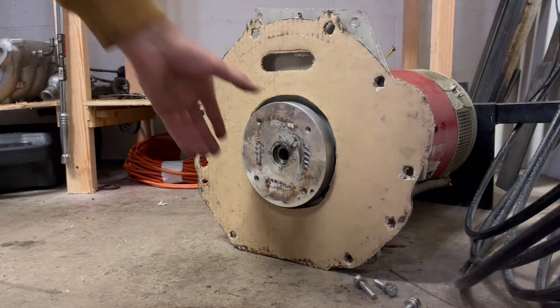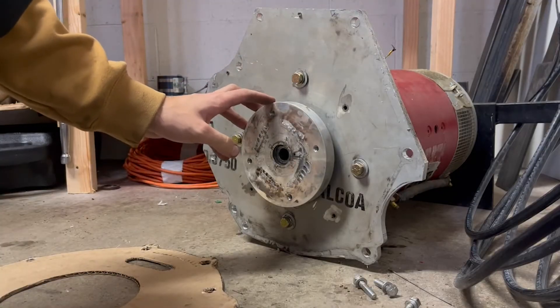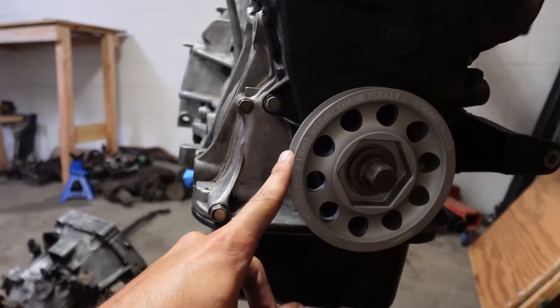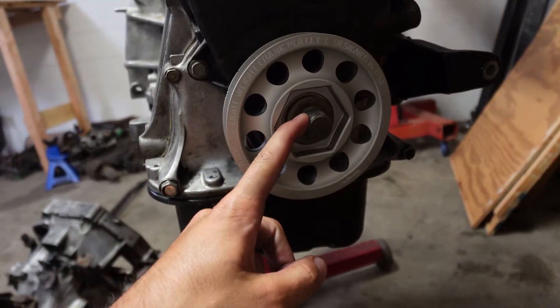The first step is pretty simple. We just mount a rotating aluminum plate to the motor output shaft, press it on, and lock the shaft and the plate together using a small piece of metal in the keyway. This is consistent with the way crankshaft pulleys are installed on combustion engines, but in our case we just don't have the bolt to hold it in place. The rotating plate really just provides a substrate for the female portion of the coupler.